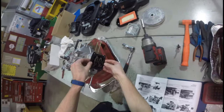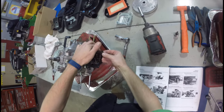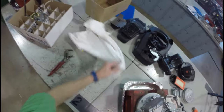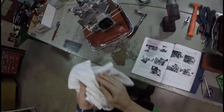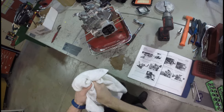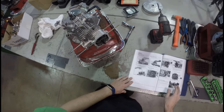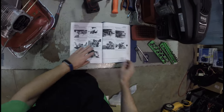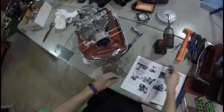Flywheel cover off. Check this gasket out — there's some oil in there. We can remove the jam nuts and pivots. So this part also — we'll just remove it all in this instance here. We have to be a little bit careful. This is the part where I'm going to have to use an open end wrench to hold down the bottom part of this valve assembly. Give me a second here while I get the correct tool. I think it might be an eight on top — no, it's a ten. I might be able to get these off without having to hold the whole thing — nope. I have to get an open end wrench — I think it's a fifteen on the bottom.